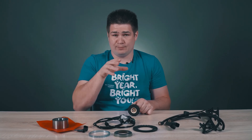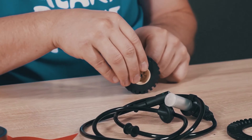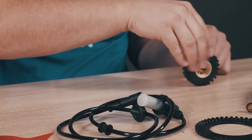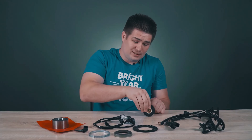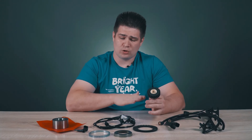The wheel starts to slow down, and when it has almost completely stopped, the ABS system abruptly releases the pads. The wheel then rotates again. Then the ABS system compresses them again and the wheel almost completely stops. ABS keeps doing this on-and-off cycle, and this is how the car slows down. Experienced drivers know that when you press the brake pedal you hear a twitch — that is exactly how the ABS system works.